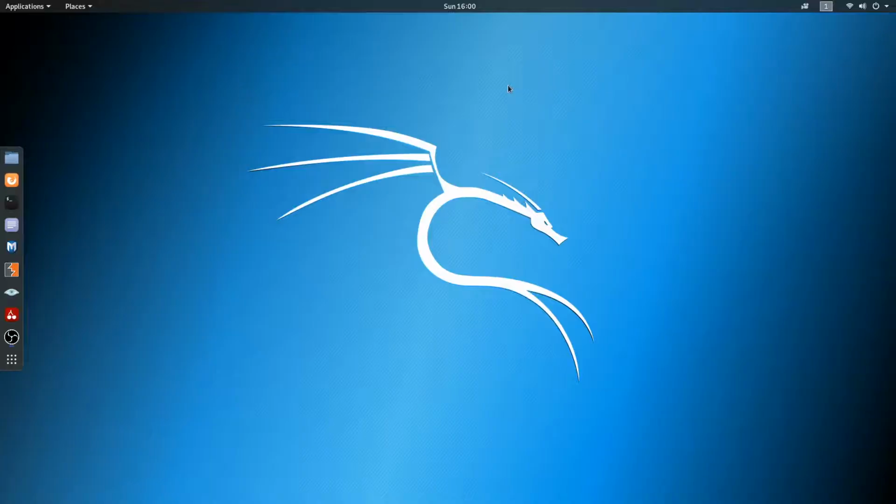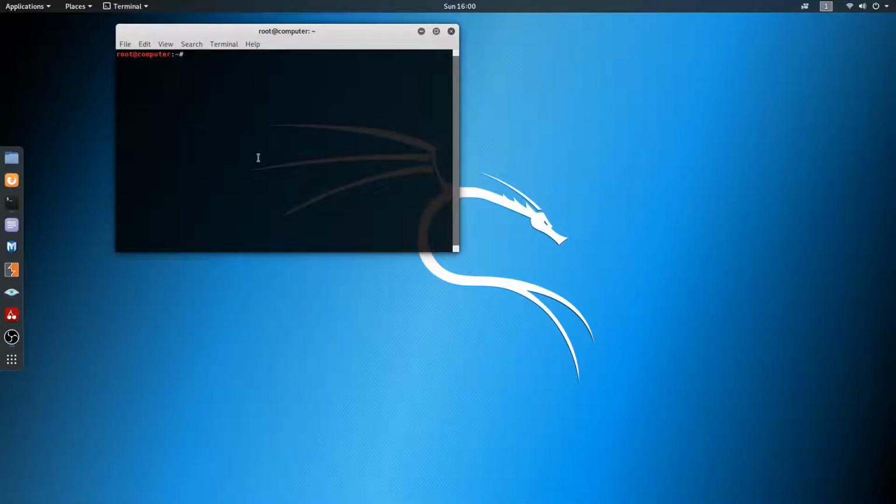Okay, now that we have our USB to serial hooked up to the serial port on the device, let's go ahead and see what we can do to it in terminal. So first we are going to figure out which USB device we're going to talk to, and it is going to be USB 0. This would vary if you have different devices hooked up. Alright, so next we are going to screen into it, so screen /dev/ttyUSB0, because that's the one that we used, and then we have to put the baud rate in, which I know this one, so it would vary from device to device.